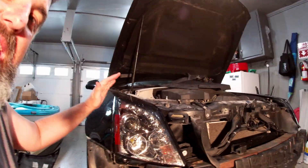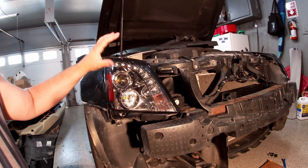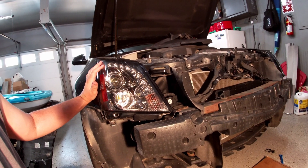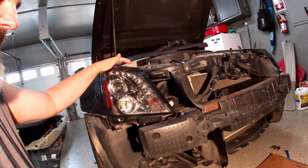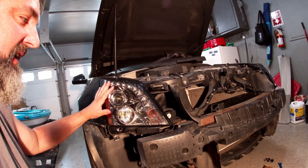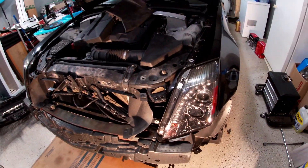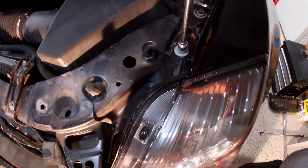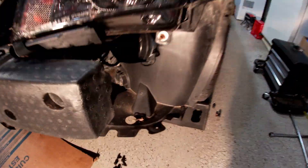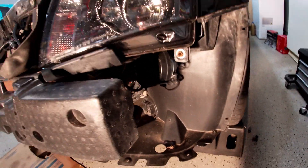I've replaced my lenses with aftermarket ones and I'm using aftermarket LED bulbs. The removal of the lens will be the same for everyone; the bulb piece will differ depending on whether you have stock or aftermarket lenses. You access the bulbs from the back side. To get the lens out, there are three 10 millimeter bolts — one on the top in the back, one on the front, and one more — and this is exactly why you had to remove the bumper cover, since you can't access these bolts without doing that. Pull all three out and then pull out the lens assembly.